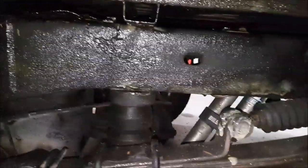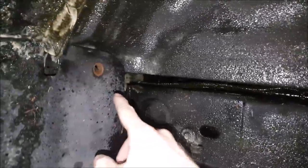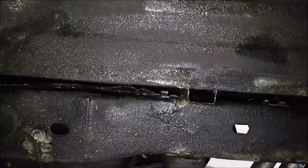So we're prepping the area. Grab your 13mm and take out these bolts because our new fender liner is going to reuse these. Beforehand, I've cleaned everything out, sprayed compressed air, used a heat gun, and got all the moisture out.